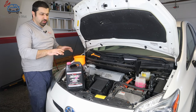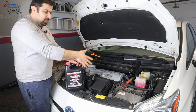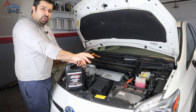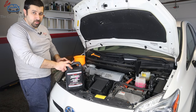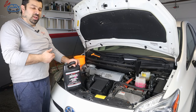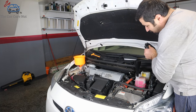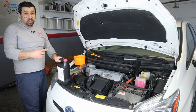Once you've done the initial fill, go to the inverter and actually overfill it slightly. As soon as that pump comes on, the level will drop fast, so fill it up — don't let that pump run dry too long because you'll hear it start making noise, which is not healthy for the inverter pump. Over on the engine side the capacity is much bigger so that pump is less likely to run low. Keep an eye on the inverter coolant — as soon as you start the car to bleed it, top it off right away. Slightly overfill the inverter, not all the way to the top but just high enough that it doesn't overflow. Now let's put the car in maintenance mode.